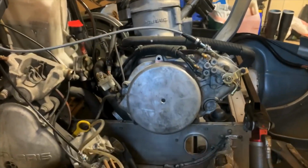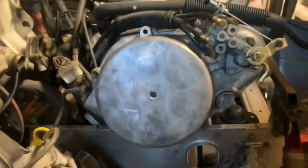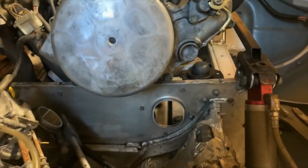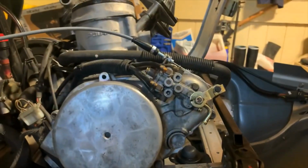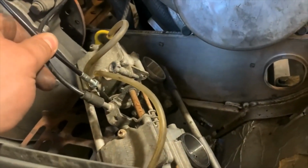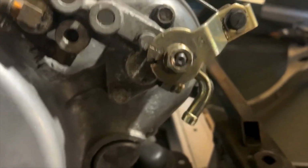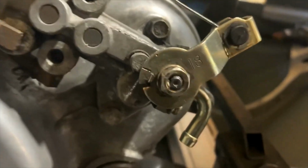So on these Pro XRs, I take a brief intermission while setting these on or into the chassis. I just set this on top of the brace for the bulkhead, and this is where I start to connect my oil cables, get it adjusted, things like that. Obviously, I already have it on my carburetors. I got the carbs set up so they go from idle to complete wide open throttle, already verified. And then from there, I hook up my oil pump, and I set it ever so rich on oil.